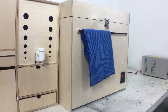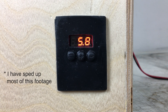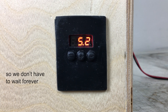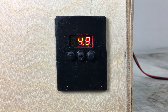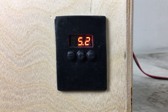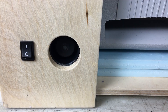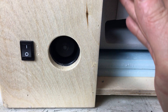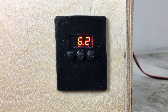So now we can go over how to set up the thermostat. For our example I've set the temperature for five degrees Celsius. If I turn on the switch you can hear the fan working and it starts cooling down because it's over five degrees. When it gets to 4.9 the cooler switches off and the fan stops. I've reached in and put my hand on the probe and the temperature has shot up to 6.8, 6.9, and of course the cooler has come back on. The secondary fan is working nicely — it blows cool air up past the cooling unit to help its own internal fan move the warm air away from the outside of the cooling unit. When it gets back down to five degrees it shuts off again.